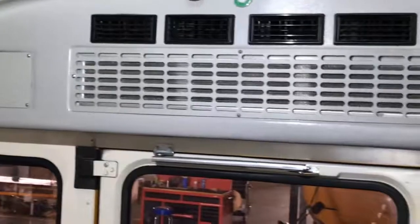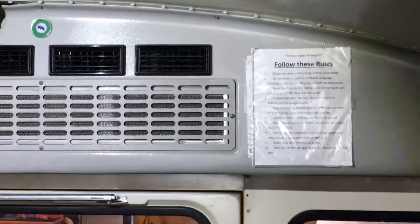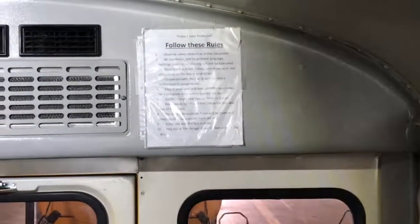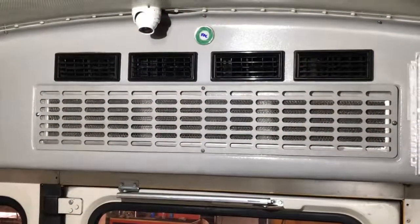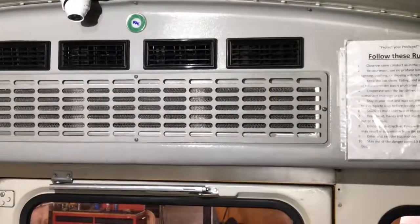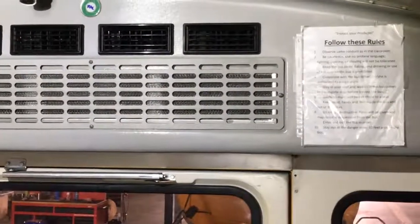A blower motor — as you saw, one of the little pegs on it was burnt out. One of the lead wires was disconnected and somewhat melted and burnt. So that was an easy fix. We just replaced that little blower fan, and now we got low, medium, high, and both fans are functioning properly. Go ahead and call this one done, guys. Appreciate you guys watching — like and subscribe.